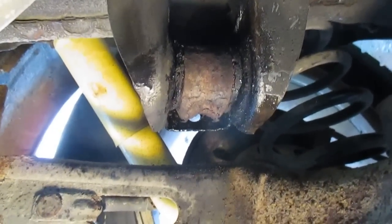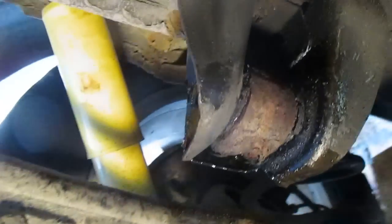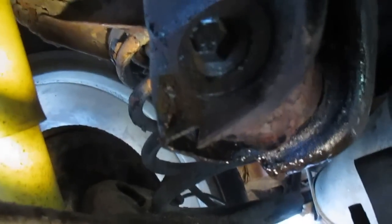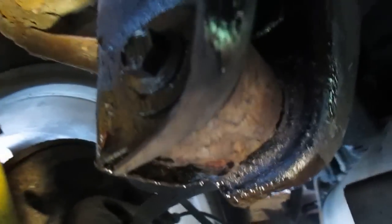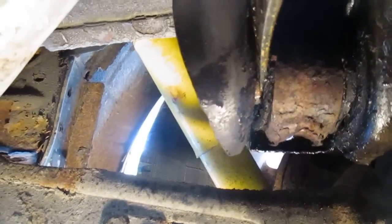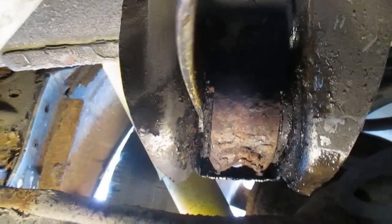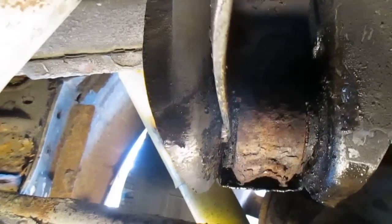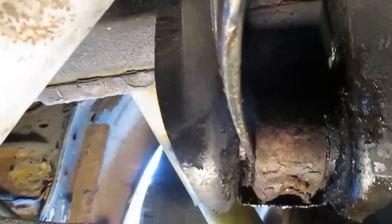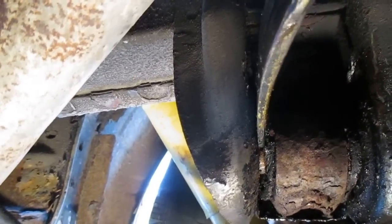I think it's starting to finally loosen up a little bit — our bushing in here. You can see where I burned away at it. Again, not recommending this. This is more of a video of why you don't want to start trying to release a seized bushing by yourself. Now that it's all been weakened by the heat and pounding, as I pry with my pry bar, we can see the rubber of the bushing and in there you can actually see the metal tube that the bolt is running through — and that's what it's seized into.